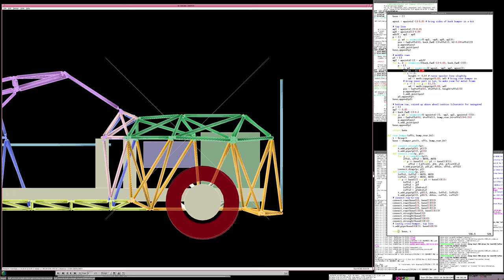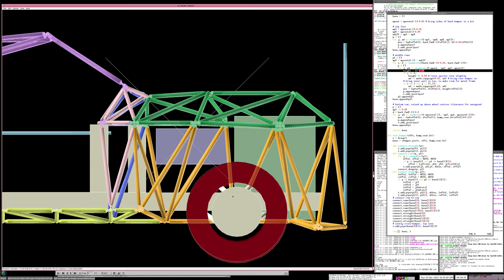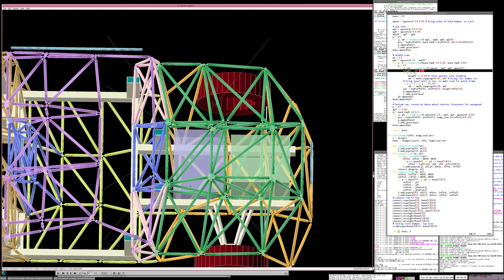Once that section is made, I'll drill through the nodes, put in bolts, add steel plates so the steel frame can attach to them. The front wishbone suspension will be attached to the steel, not to the Kevlar-reinforced pipes. The steel frame has to be attached at multiple points to the Kevlar geodesic frame in order to distribute the load.